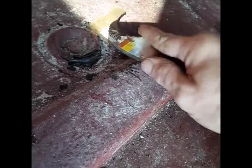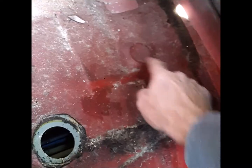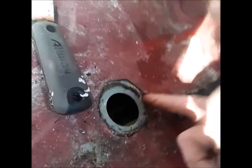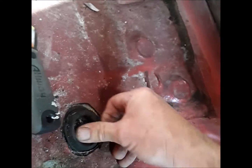A lot of times this one right here will do it, but this one doesn't go to the outside — yeah, this one goes to the outside and that one still looks good, a little bit of rust but the hole's still good. This one here stays to an inside channel and doesn't go outside — the fuel lines run through there. When you look under the floor and you see the fuel lines come up underneath and disappear, they go right there. These two also do not go outside. They fill these channels with beeswax — that's what that yellow gunk is. There's a rust preventative which is really good. I need to fill the back channels; anywhere I did welding it'll catch on fire — it's flammable. So evidently I do have a hole here, which is no big deal.